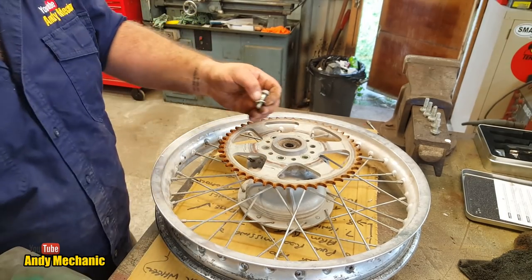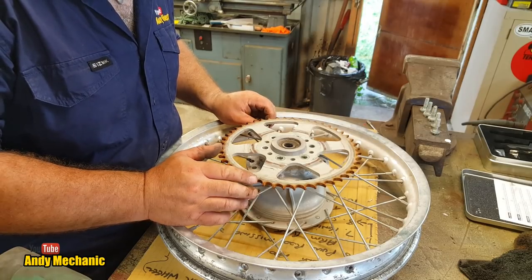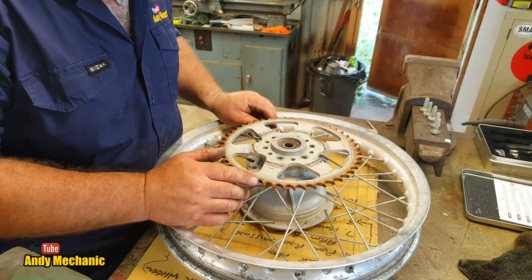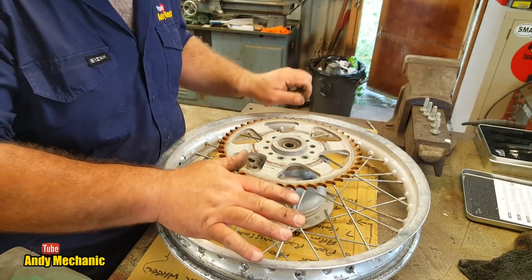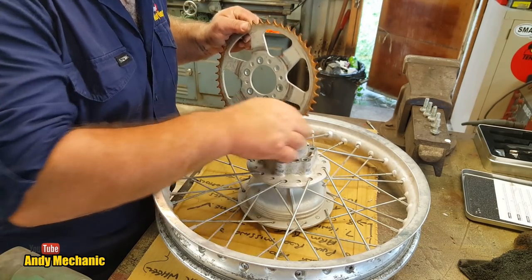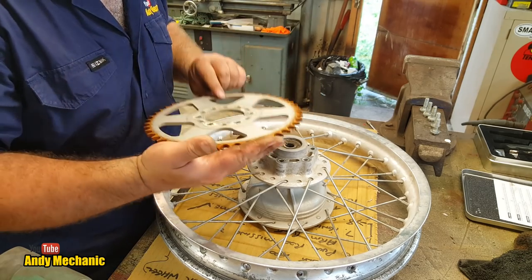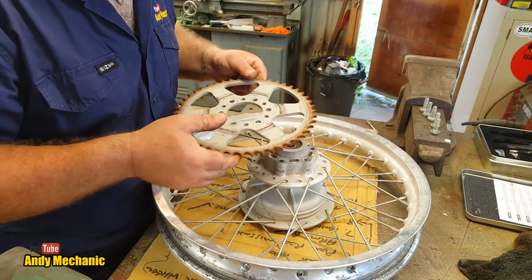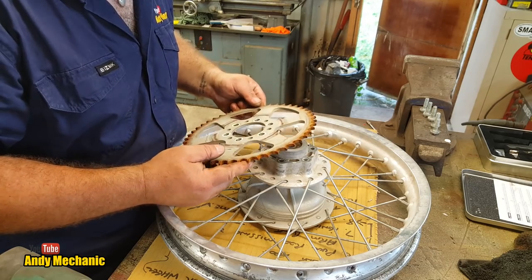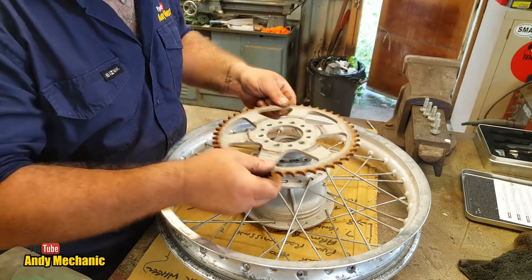I'm bending his supermoto modification from the off-road on his dirt bike. I made damn sure that he bought rims that had the cush drive system built in, because the last thing I wanted to do was a rebuild on his gearbox. And his bike's done nearly 20,000 kilometers now without any problems, and he rides like an idiot, believe me. Okay, well, that is scrap.